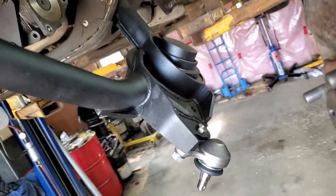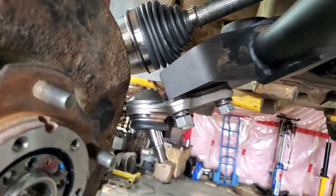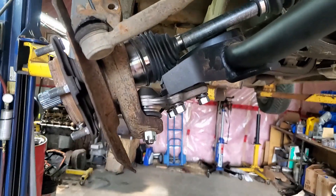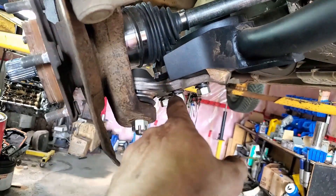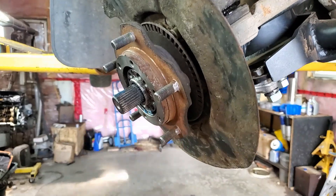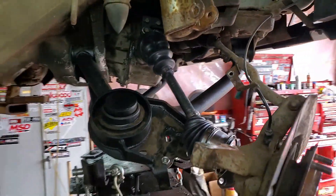The instructions say to install the new ball joints on the lower side of the control arm, which I've done on both sides. On this side I'm doing a slightly different procedure because of how the axle goes in. What I did was put the ball joint in the steering knuckle first, then slid the axle into place, then put the bolts in for the ball joint. I find that's easier on this side because of how long the shaft is. The front springs have a crazy taper - those are the rear ones; the other ones are the front.